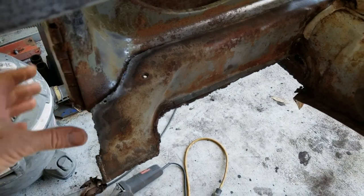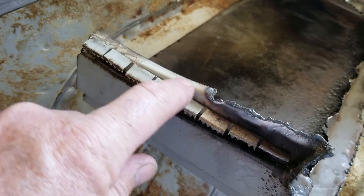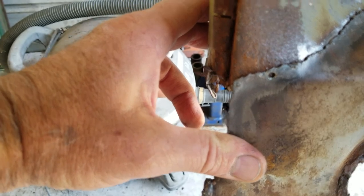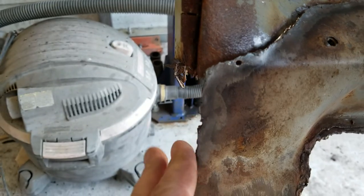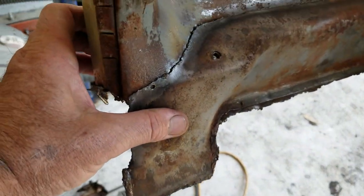I've been checking this out and it looks like this panel is just gonna drop right in, so I'm not gonna have to cut these. Everything lines up because when I cut this, you can see there's a bend right here and I cut this edge right on the bend. You can see the width of the cut and it's right there within a sixteenth of an inch of the bend. The width of this is actually slightly past the bend, so it looks like it's lined up perfect.